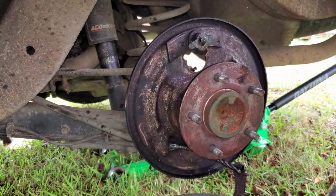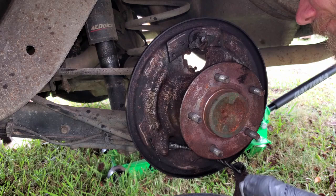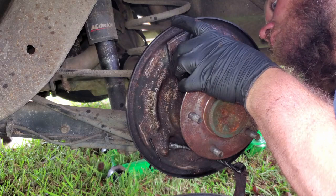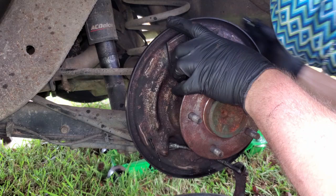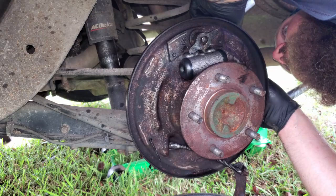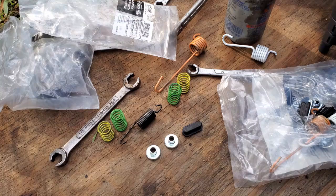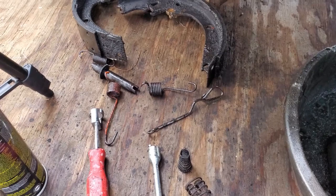The quality of stuff is just getting terrible - I mean it's really supposed to keep junk out but it has a hole in it. All right, installation - I would say is opposite of removal, but it's kind of not. You really want to hook your brake line up first because otherwise you're fighting your brake line trying to get it lined up just right. It does need to be just right in order for it to thread in. Do that first while you still have some movement. That also stops your brake fluid from leaking all over sooner. Don't forget to tighten your brake line.